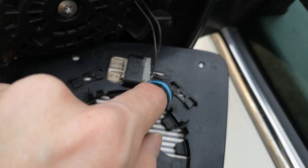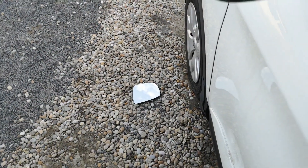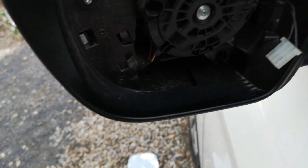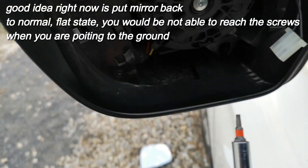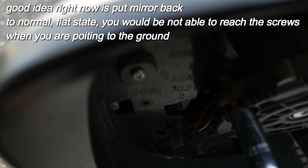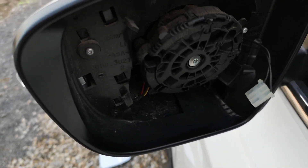After this part you can disconnect the heating of the mirror. You need to watch out for the small retaining clip — let me remove it. After disconnecting the mirror from the small clip and the connector, you need to put down three screws from the mirror engine — one, two, and three. Then the mirror engine will drop down; it's still connected to the cable so you won't break it.